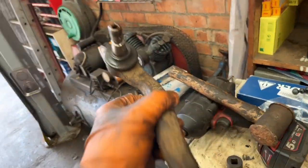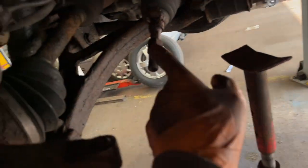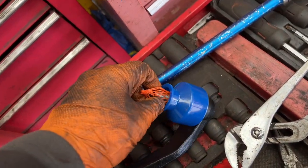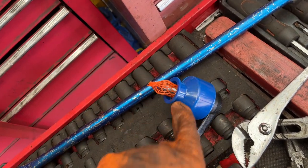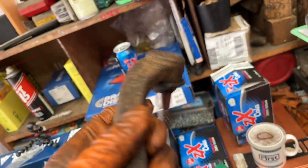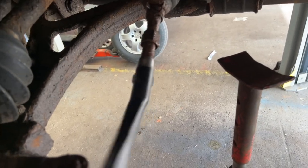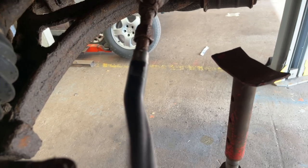Now we clean up the threaded bar — the tie rod gets plenty of grease on it. Get the new one ready — I like how it comes nicely protected. I'll leave the cover on until it's in place, then put a bit of grease on the face. I'll also show you the old one while I'm here. Grease on the threads so if I need to do any work again, it comes apart easily. Now just screw the new one on — I should really count the turns, but it's going in for four-wheel alignment.